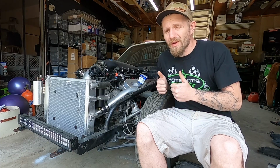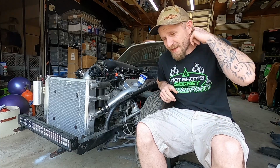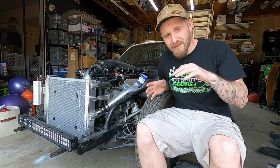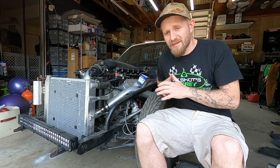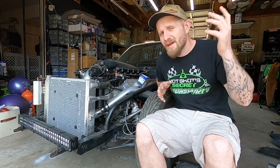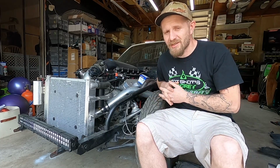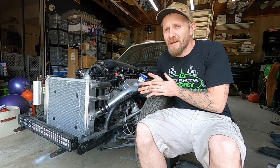At that point, we were hitting a safety cut. Derek has programmed a number of safety cuts in the system, so if certain things don't line up, pressures aren't right, that kind of stuff, it will just do what it did there, as you guys see. It won't let me do anything. It won't let me bring the RPM up. It just cuts the ignition, and we're stuck. Brought it back over by the trailer, looked at the log, tried to figure it out.